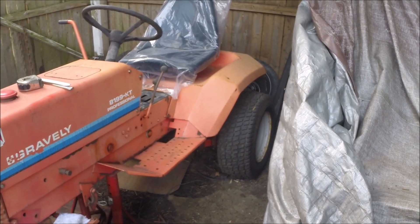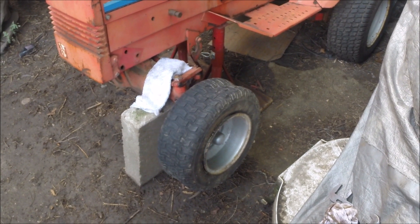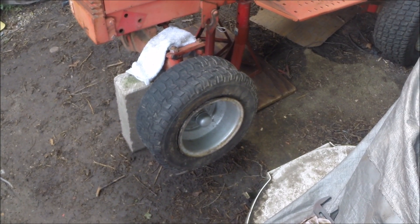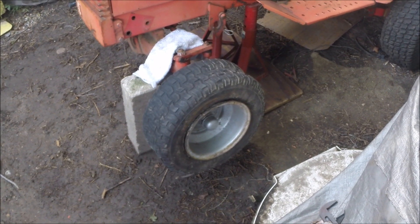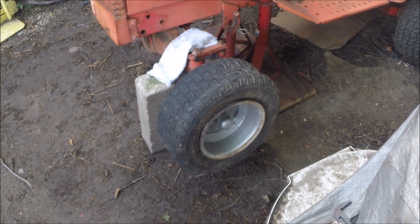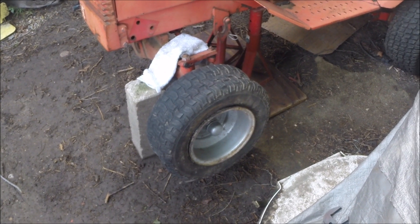I've got the rear tires mounted and everything — that'll be really easy to put those on. But these fronts here, I'm hesitant to just slap new tires on and go, because what I want to do is put new bearings on. Even though this is not the wheel that was on here, I went ahead and threw this on to show the entire process: removing the wheel, taking the tire off, removing the seal and races, installing new races and bearings and seals, packing the bearings, setting the preload — the whole process.